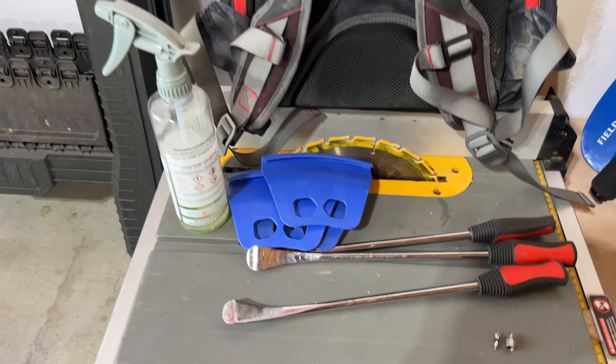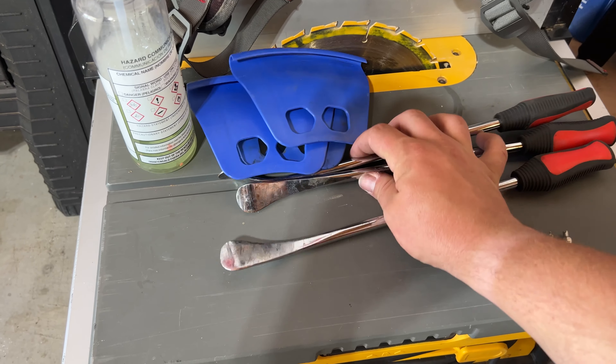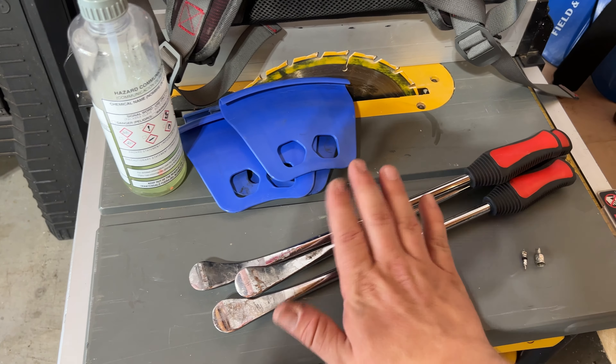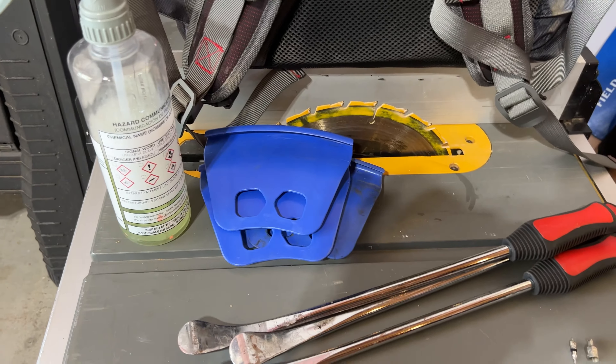Here are the tools I'm using — my unplugged table saw as a benchtop. I have three good tire irons; three is pretty decent, though I'll sometimes use four for a really tough tire. I have Motion Pro rim shields to help not mar up your rims when using the tire irons to pop the beads. For the air compressor I'm using the Milwaukee M12 — that should be fine to seat the bead. I also have some soapy water to help put everything back on and pop the bead. The new Moto Z tire comes with a cardboard spacer inside that helps keep the bead set apart, so seating it shouldn't be an issue.